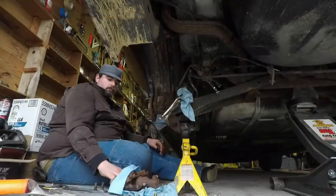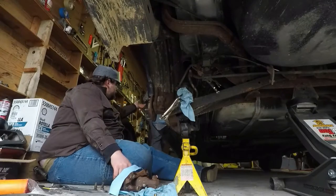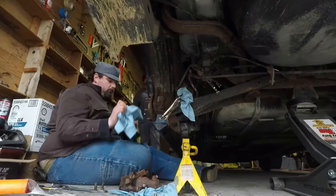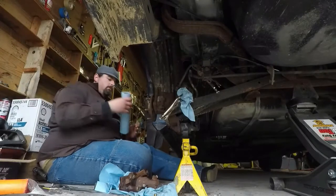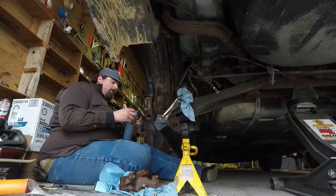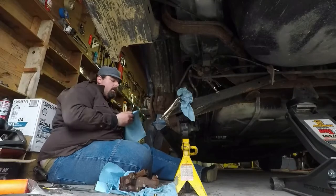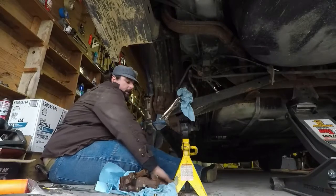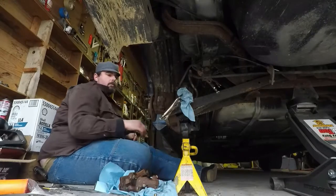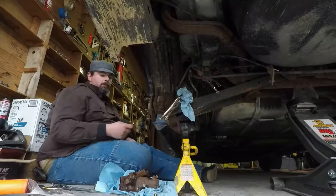You do all this, and it still cooks the brake caliper again and screws up this brake. Then we're looking at an ABS module or brake distribution block. At which point I'm bypassing, getting rid of the ABS, and I'm going to put racing brakes on it. Because if I got to do all that, I'd rather spend that money putting real brakes on this thing instead of refixing the undersized brakes it came with.